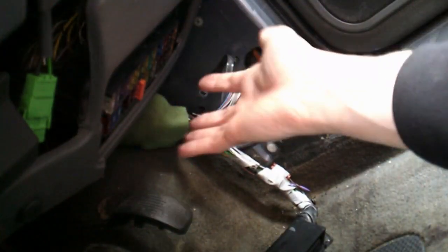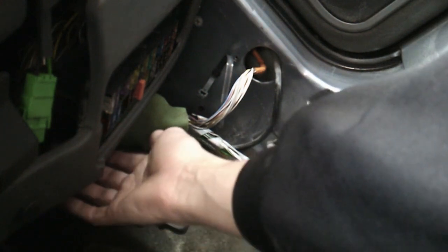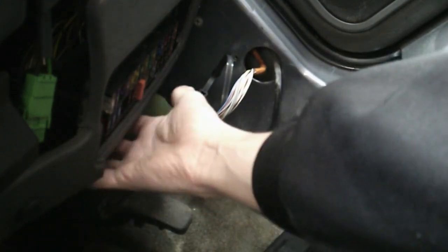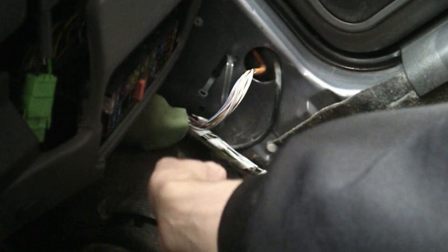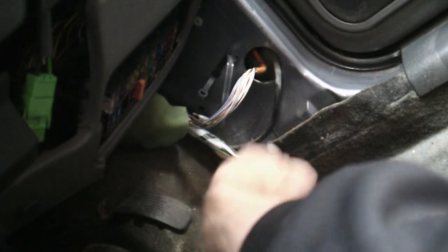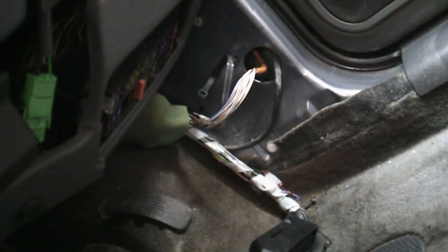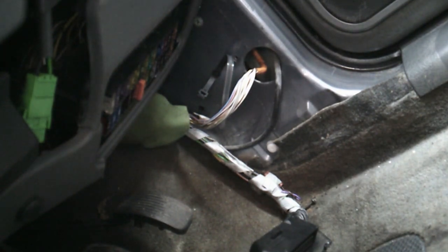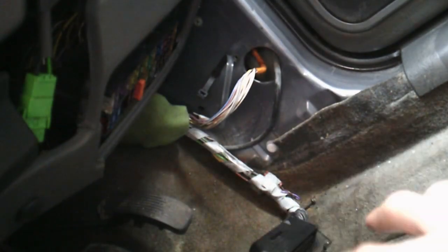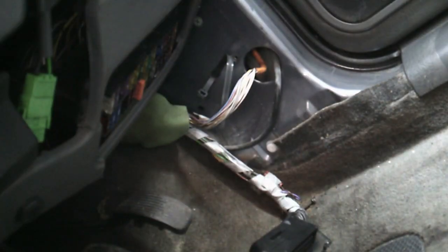I have looked underneath here, because under here are the relays that click away — that was the source of the problem. And under here it looks remarkably dry and all sealed up, so I don't think we've had a problem with water getting in, at least under here. Now the ECU's out, what I'm going to do is reconnect the battery and we'll see if the relays make the clicking and clacking noise. My suspicion is they won't, because now the ECU's disconnected — if that's the source of the problem, it should stop the clicking and clacking. It's not a perfect sign, but it's the best plan I've got so far.